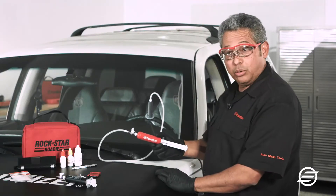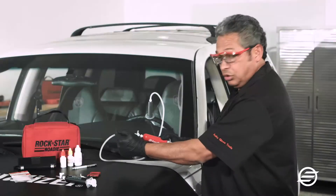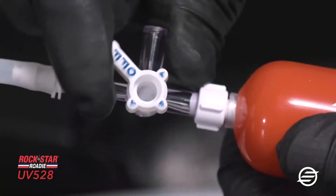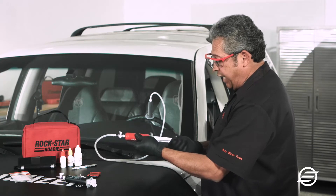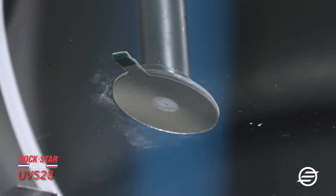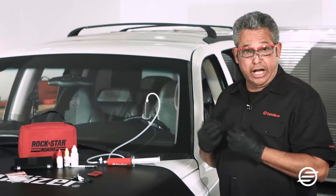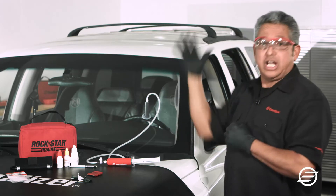I'm going to release, turning the valve to the left, then put the plunger back in, closing the valve again and creating extra vacuum. We'll let it sit for five minutes. If the break is reacting, I can see the air bubbles being extracted. If you can see bubbles coming to the surface, that's a good sign — the resin will be on the bottom and all the trapped air is coming to the surface.